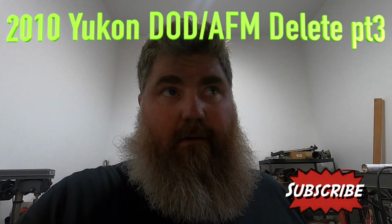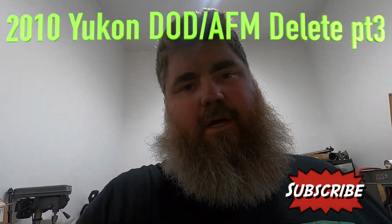So we got the Yukon up and running, we got the tune on it. We did have a misfire, it was acting all funny. Put new wires on it, it got a little bit better. And then there was still a spot where it was acting funny. Talking with the tuner, he says there was still a misfire. So I pulled the first plug, and actually, the number one hole had broken.